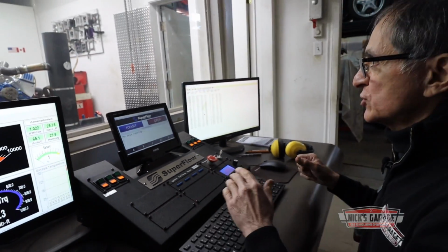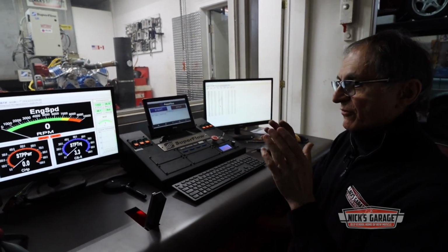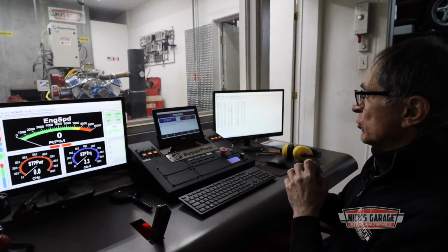But for some reason, it runs too lean. I've richened it out. We had the same issue yesterday. We've richened out the jets, and we have again the same issue. I know it's a one single feed, and for some reason, it's not doing the job. Okay, I'm just gonna check one more. I just want to make sure I got enough fuel pressure on my fuel line. So I'm gonna start it up, let it idle, check my gauge.